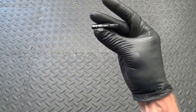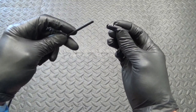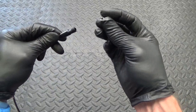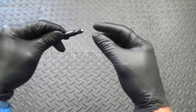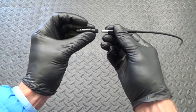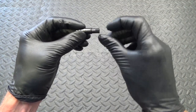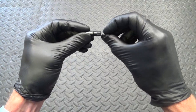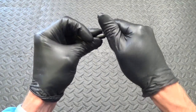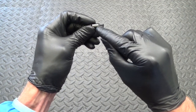If you're using a barrel adjuster, the side that says 'up' on it just has the normal outer cable going in. The opposite end has a ferrule on it that goes in there, then your outer cable goes in after the ferrule. Make sure that the barrel adjuster is screwed in all the way before you hook your derailleur up - screw it in all the way until it's at the bottom. You can see that last line just there - make sure it's fully screwed in before you hook anything up.